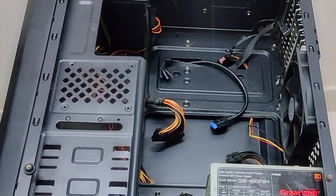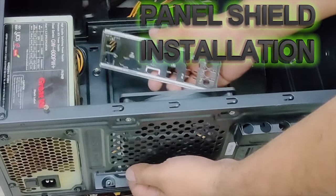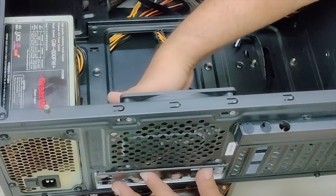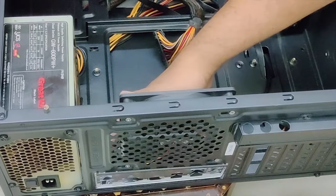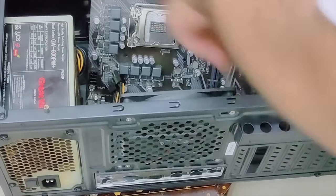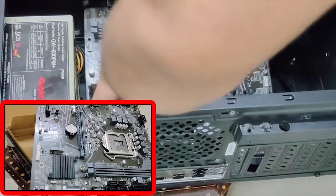The panel shield or IO plate is a bit tricky to install. I prefer to fit it in the case first rather than fitting it along with the motherboard. If you want to watch the unboxing of this motherboard, check out the link in the description.